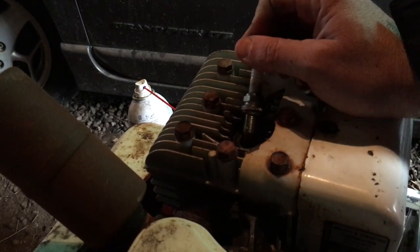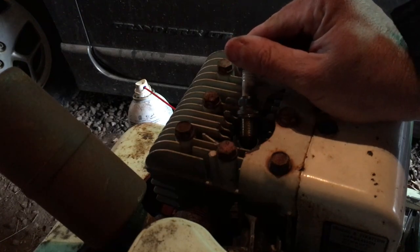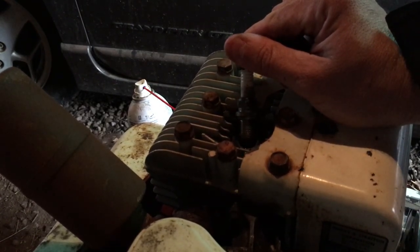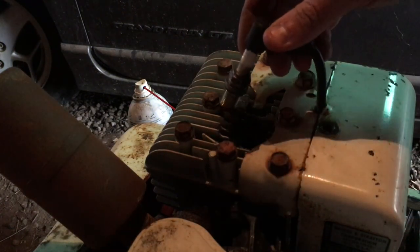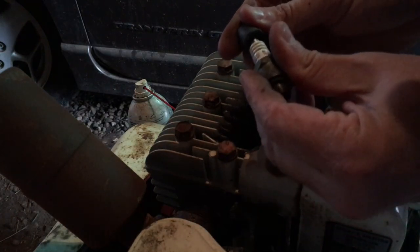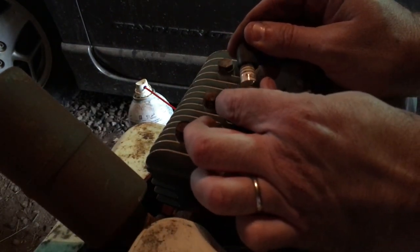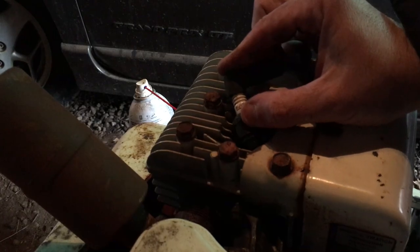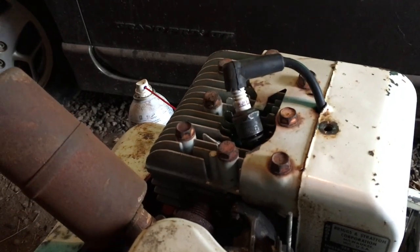I have some faith it's actually working because it worked a little bit there — trying to get it on film is just impossible. So it's sparking, which is good. I just need to get the spark plug seated properly; the threads are so tall it's not going to seat well. Let me pull this one out — that's a nice tight fit. I'll put in the RJ19. I wonder if there's an issue with the different types of coils, and my non-attached pull doesn't like to be at an angle, but I'll find out in a sec.